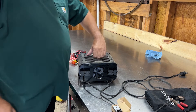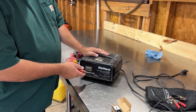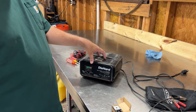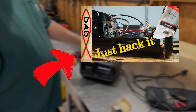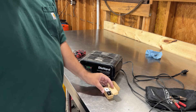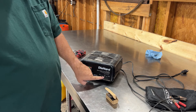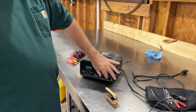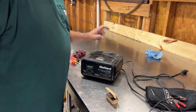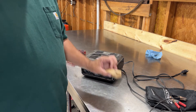I'm finally going to get to working on this — it's been sitting on the workbench for a long time. I did a video on it way back and I may actually have to go watch that again so I remember how to do this. I ordered these probably two years ago, maybe even longer. They're 50-amp rectifiers. I think what happened is it quit working because it got flipped to 10 amps, but the old rectifier in here is only like a 5-amp, so I finally ordered these and I'm going to get around to hooking them up.